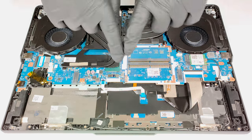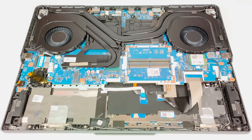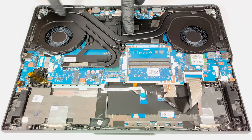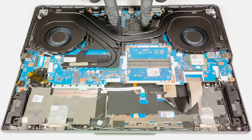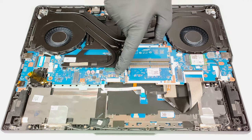As you can see, the cooling looks seriously big. It has two large fans, one thick heat pipe shared between the CPU and the GPU, one more for the processor, and two solely dedicated to the video card and its memory and voltage regulators. We can also see four heat sinks and two huge metal plates. The one on the left is also for cooling the chipset, which is a nice touch.